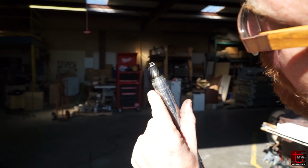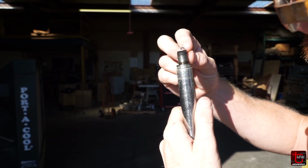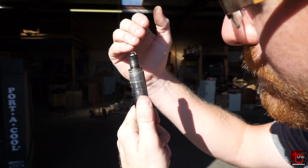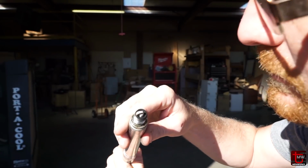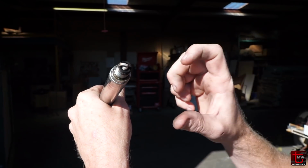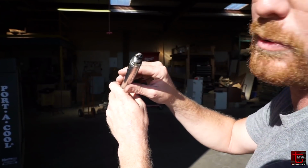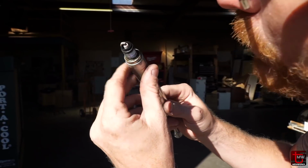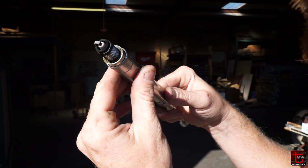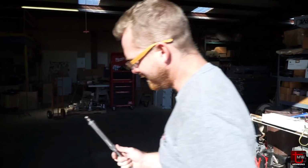You want to explain to everybody what you're looking at? Well, I'm looking at the color of it, the cleanliness of it, the lack of speckling, the distinct color change on the strap, and that it's happening in the middle of the strap pretty much. So I know I'm safe on timing right now. I'm looking at this circle that it has an even color, but it's not black. So while we are running a little bit rich at times, it's not accumulating on the spark plug. No speckles. Man, it looks so good. That is so happy right there. It looks content to do another 100 horsepower if it's available. No doubt.